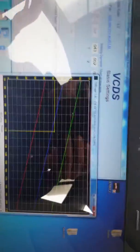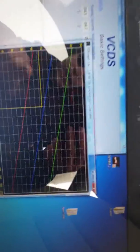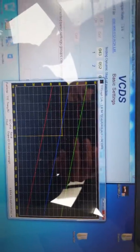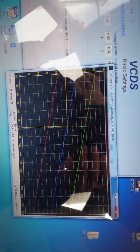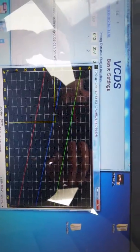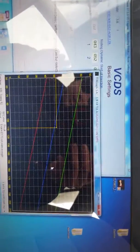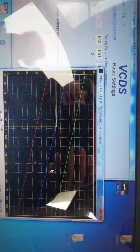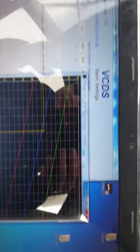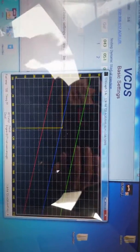I personally like to have it slightly above the blue line. Right now it's right on the blue line — possibly because my temperature isn't at 90 degrees yet. Right on the blue line is perfect, but if you want a bit more power, easier cold starts, and slightly better fuel economy, you can have it a hair over the blue line. The important thing is that it stays between the red and green lines — I've seen the yellow line close to, at, or even beyond those limits.